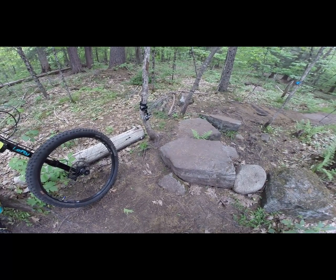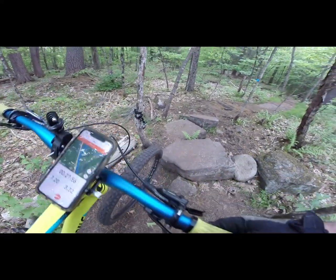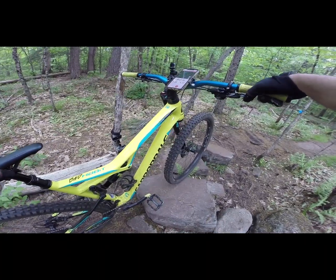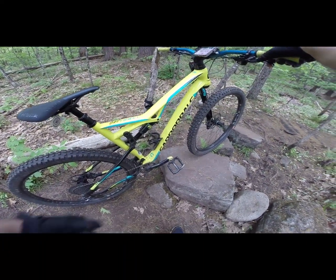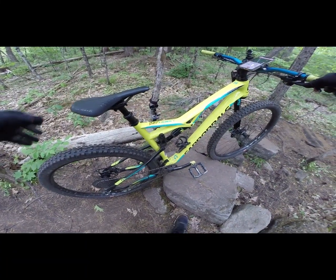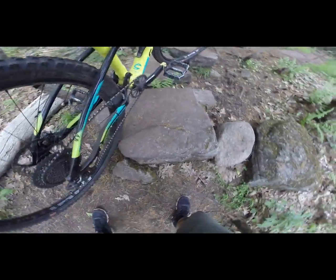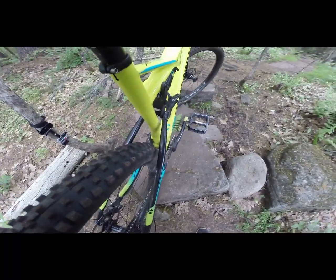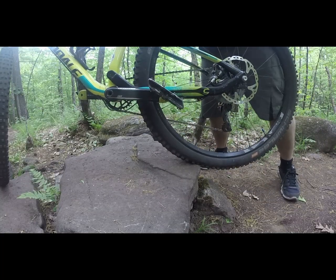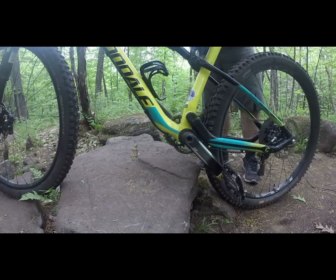Let's get these things on the wheels and try it out and see what things are like. Three weeks later — while I was out here, I did want to give you guys another update on the CushCore idea that I've been messing around with. I am out here right now doing a quick video on trail tips, and it occurs to me as I'm riding that I've forgotten just how much these fake CushCores have helped. I'm probably running about 14 or 15 pounds in my back tire right now — I don't typically run that soft; I'm normally in the 20 to 21 pound range. Even though I'm riding over a lot of really sharp, jagged stuff, I'll give you a shot at just how soft these tires are. You can see I'm able to get quite a bit of sink in there, and you'll notice I'm not pinging that rim because the foam in there is taking the bulk of that hit.